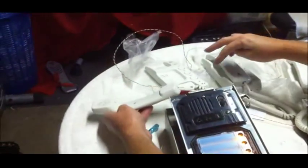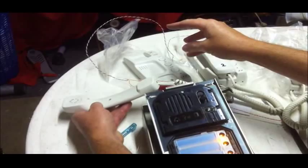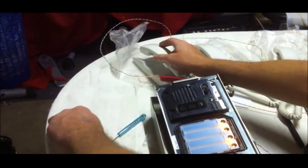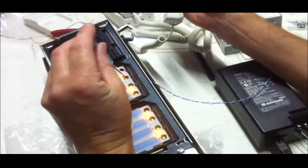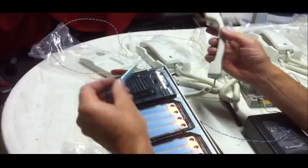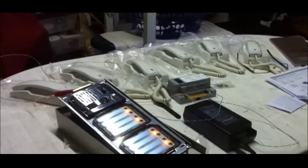When you get these fresh out of the box, press the bell and key button together for a period of time — this talks with the unit down here and tells it the handset is ready to be programmed. Then put the handset back down, pick it up again, and press the numbered button — for example, press one — briefly, just for a split second. A light will show confirming the phone is programmed to that number. If you hold it more than one or two seconds it'll start to flash, meaning you've deleted what you just did and started from scratch. That's it — power it off. Thank you very much.